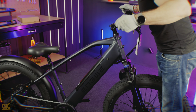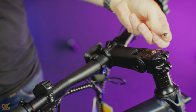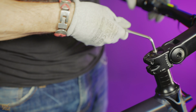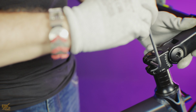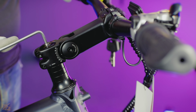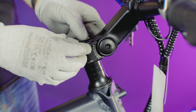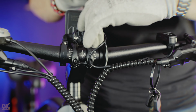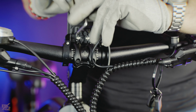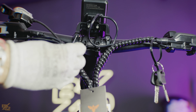With the wheel and the handlebars installed, align the front wheel and the handlebar. Once aligned, securely tighten all the stem screws. Adjust the handlebar height for optimal comfort. And remember to replace the rubber cap. Ensure the handlebar is securely fastened by tightening the 4 top screws. Adjust the display to your preferred position and securely tighten it using the hex key.